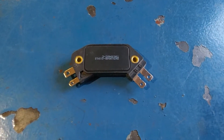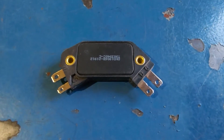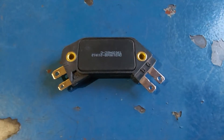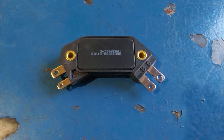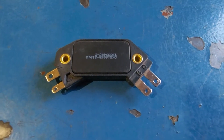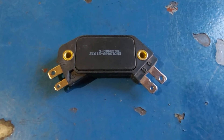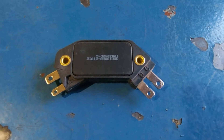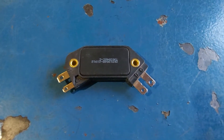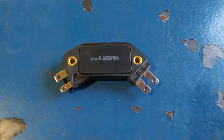We'll start with this simple, most common GM 4-pin module. They started making these in 1975 to replace the points distributors. These were very common in the late 70s and then made all the way to 1989, but started becoming a lot less common in the 80s as they started getting replaced by the other modules I'm about to talk about.